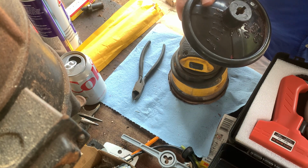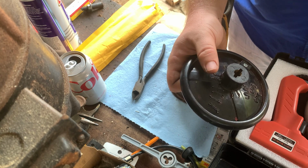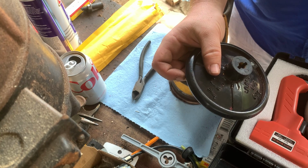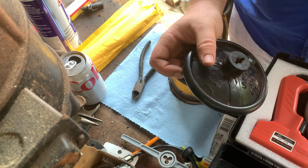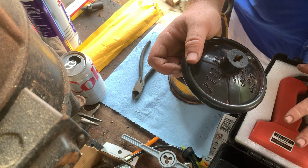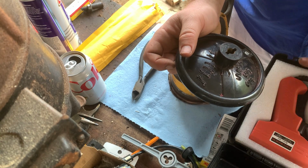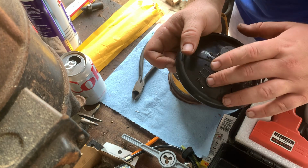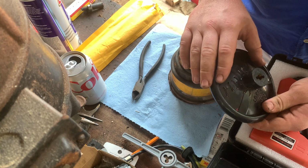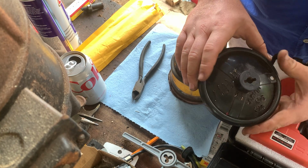And you can get a die grinder and go through this if you were doing a bumper. Grind down all these little stubs here, and take the other half of the plastic welding kit that you would normally get when you buy this. They're two separate kits, but they go hand in hand together. But you would grind down all of these and then take the welder and smooth everything out with new plastic, or reuse the plastic that's already there, that's raised up, depending on how much you take away. But yeah, that's how you use it.